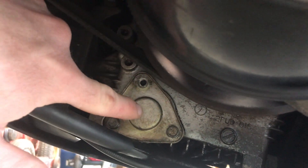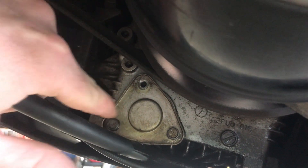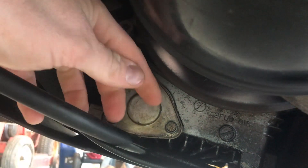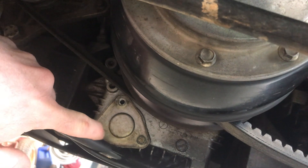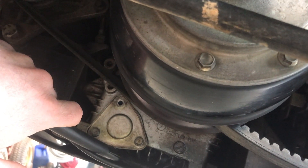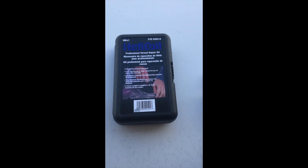Here's that triangle I was talking about. There's a screen on the other side and there's an O-ring that seals around here. This bolt acted fine, that bolt would never tighten up, and this one seemed like it was pulling the threads out. It's on the side of the engine with the primary clutch, and I'm hoping I don't have to take that off to drill it out, tap all the holes, and put the inserts in. Here's a helicoil thread repair kit.